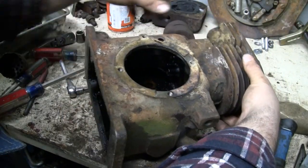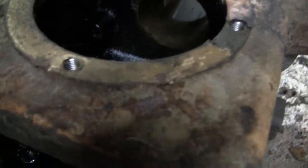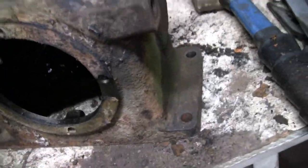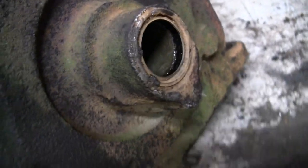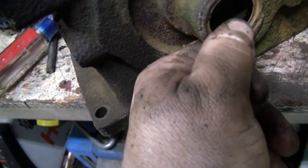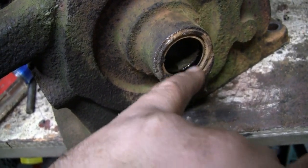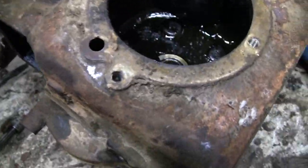The only other thing that I forgot about is there's a small little disc type check valve right in here, which allows the oil from the magneto side bearing to drain back into the block. That little casting boss down there, because there's no real seal here. Well, I shouldn't say that. That is technically a lip seal, I believe. Right? Yeah, it's a crusty lip seal. So this gap from the bearing, the bushing between the seal, any oil that collects there, it allows that to drain back into the crankcase, but prevents crankcase pressure from kind of blowing out the seal itself.